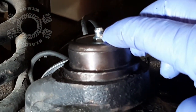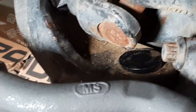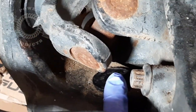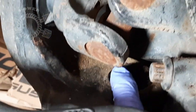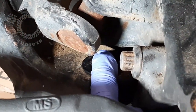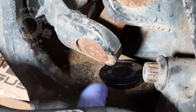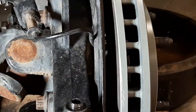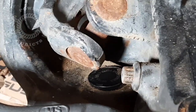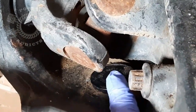Here are the standard fittings, and they have another set that's really really short - the only thing they do is shorten the shoulder. Then you have the needle style which goes right to the edge. I prefer the needle styles on these. These particular ball joints are the non-greasable lowers and of course we have the greasable uppers, so pay attention to that. You'll have the grease fitting either in the middle or on the edge. If you happen to have the ones in the middle and it's not the 90-degree style - 90 degrees means they come up this way and bend back at you so you can pop your grease fitting in - you will have to pull all this off, pull the axle and come in from the top to grease it. Hopefully you don't have that style because they're a total pain just to do a little preventive maintenance.